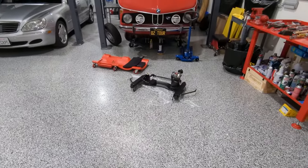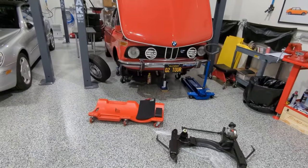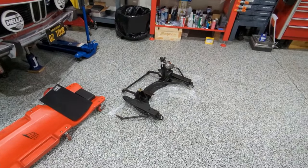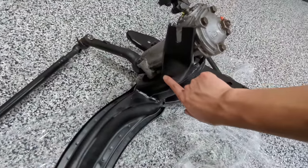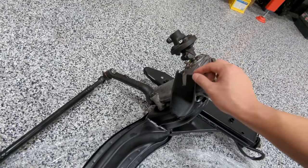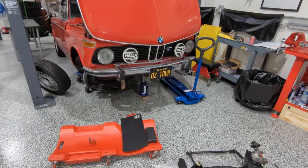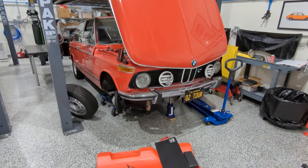So in terms of other car stuff going on, you can see that my 2002 right now is in pieces. I had a cracked front subframe where the engine mount was. So basically this area here, it cracks from just over time the vibrations and stresses from an engine, especially an engine that makes 50% more horsepower than it did from the factory 40 years ago. So that subframe cracked, and so my car has been out of commission for a couple months now